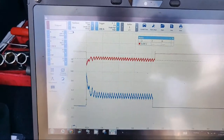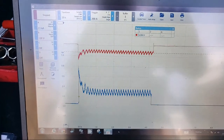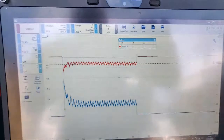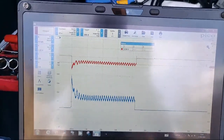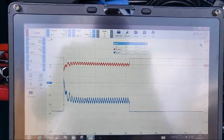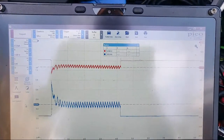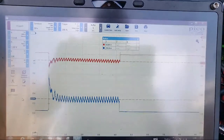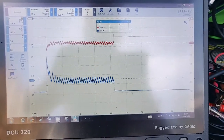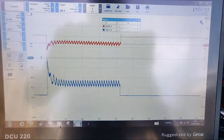The important stuff is the current clamp. Notice I didn't turn the clamp on or zero it - it auto-zeroed. Let's drag our ruler down from the left hand side. Average cranking: 293 amps. And we peak at roughly about 780 amps.